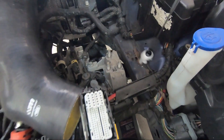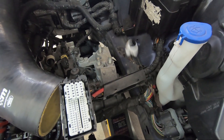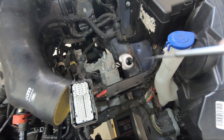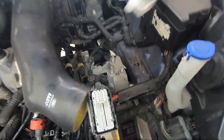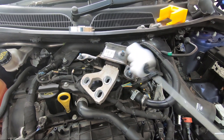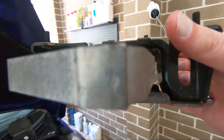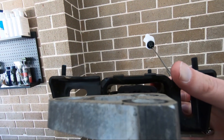We're out already. We've got the two bolts and then the three for the actual mount. You can see down here we've got the jack. What Mitch has done is gotten the chassis bolts out first, jacked up the gearbox a little bit just to take the pressure off, and then removed the mount from the actual transmission itself. There is quite a bit of play in that — it's got holes all around it, built for comfort not for speed.